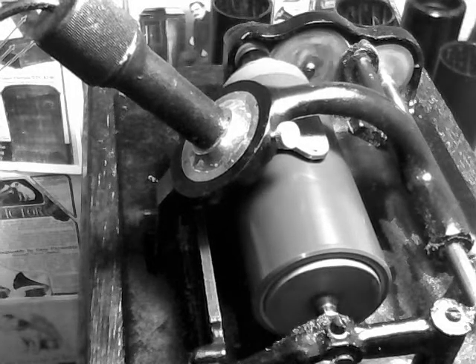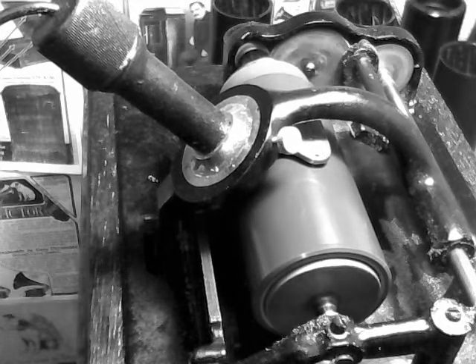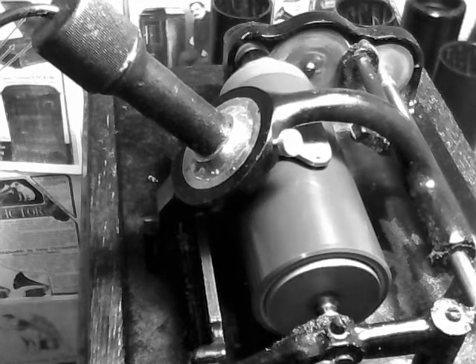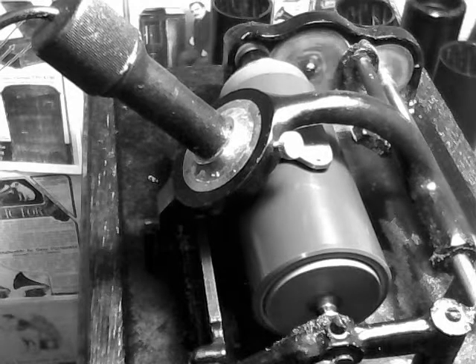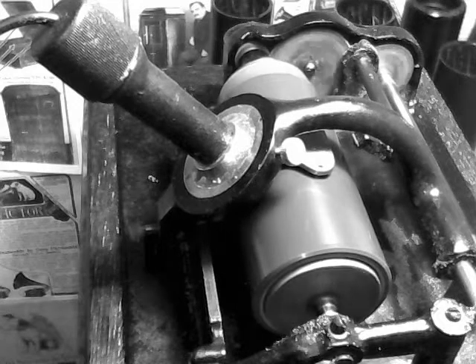There's really no way around that except to clean the machine every single time you make a recording. Once you let the swarf build up on the gears, it usually requires a toothbrush and either charcoal lighter fluid, kerosene, something like that to really break that wax down and get it out of the gears.